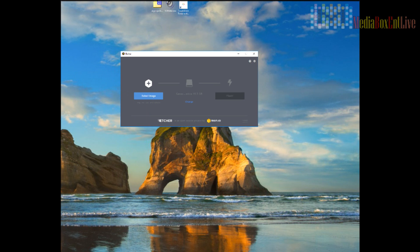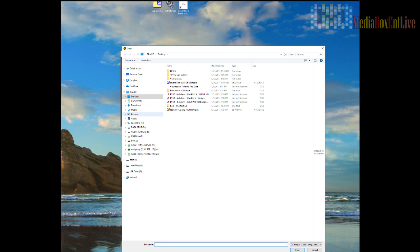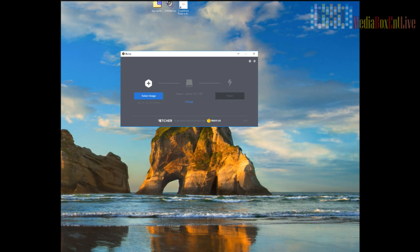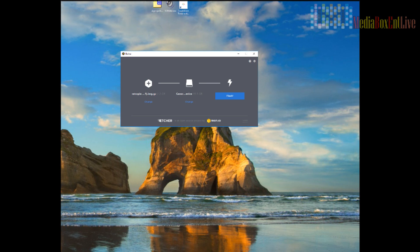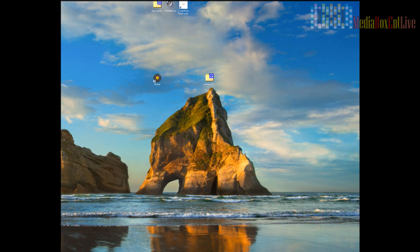Now load the image writer. Click and select the image from your desktop, click Open, and wait — it will detect your drive. I recommend removing the verification option because it can sometimes give an error, and it's always fine without it. Click write and it's going to take about three minutes. When it's done, remove the memory card.